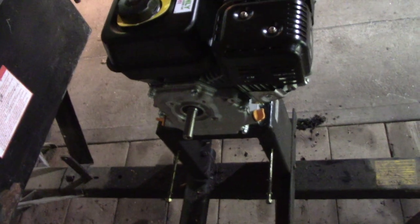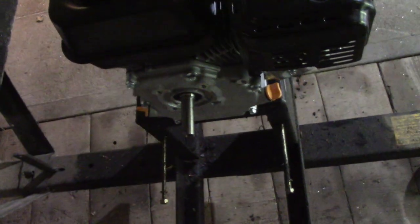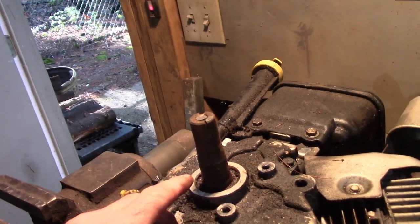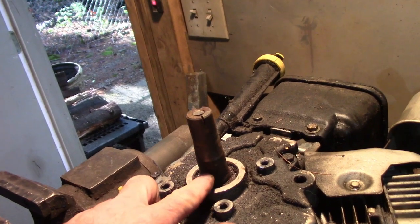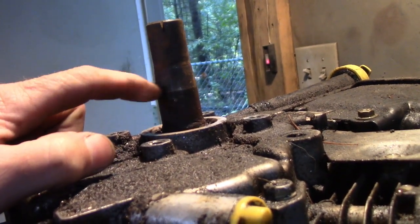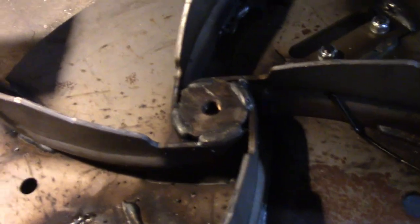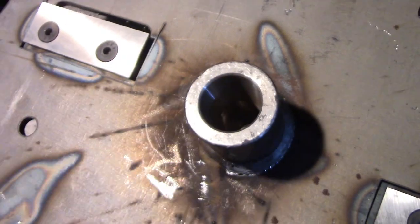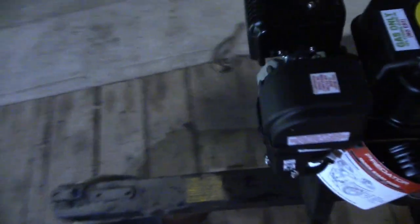There's so many things to address here. The shaft is not only three quarters, it's also shorter. This shaft here is two and five-eighths coming out of here, and that one's two and a quarter. So we're going to have to make up a half inch. This is an inch down here, tapered to seven-eighths up here. Can't find this engine anywhere — I looked high and low. We're going to make this work. I'm going to use that cheap-ass $150 motor if it's the last thing I do.